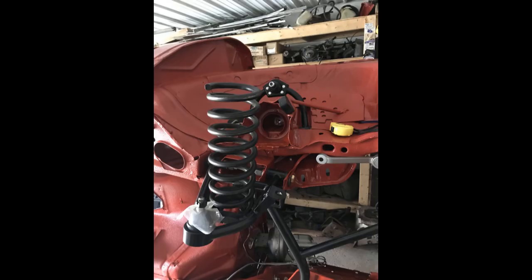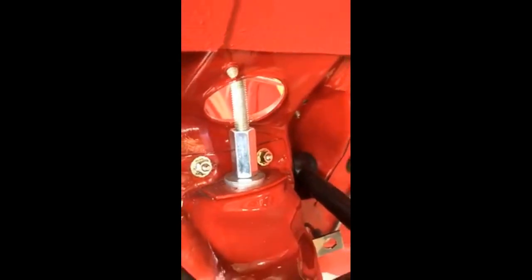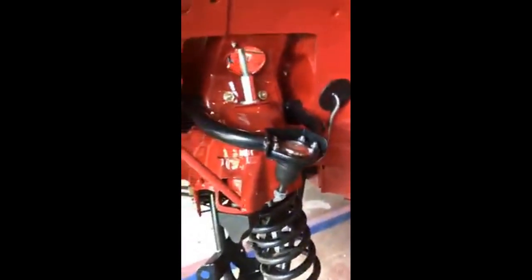Here's the spring sitting in the lower A-arm pocket — it needed to be compressed quite a bit to get it in here. I didn't have the spring insulators anymore, so I used a piece of 5/8-inch heater hose to insulate the spring against the car body. Using the lower half of a spring compressor, a piece of threaded rod, an inch-and-three-quarter long threaded rod coupling nut, another nut on the bottom as the jam nut, and another one on top — and I greased the washers. I've got enough room that I don't have to take off my booster.